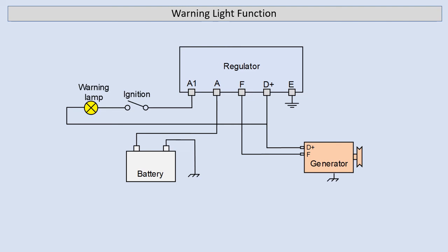The last thing we want to see quite briefly is how the warning lamp functions. First of all, when we close our ignition switch, you'll see we have battery power — we have positive on this side of the warning lamp and the warning lamp receives its negative through the generator through the armature circuit. The moment that the generator begins to charge, we then put a positive on this side of the warning lamp as well. And because we have no potential difference across the lamp, it extinguishes.